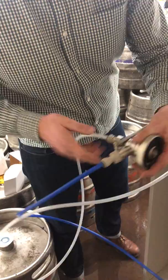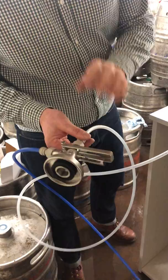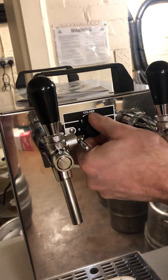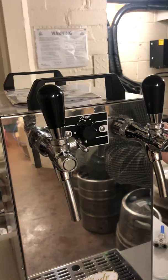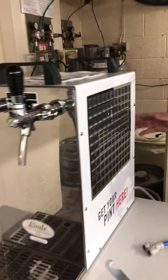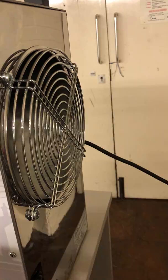So that's all the components installed on the machine. We can now connect the machine to the mains supply. We can switch the machine on at the front — zero being off, seven being the coldest setting. So if we turn that round to seven, the machine's just kicked in as you can hear. That will run for probably around five minutes to come down to temperature. Seven is the coldest setting, so we can hear the refrigeration deck running. If we look at the rear of the machine, we can see the fan spinning — that tells us the machine is currently running to bring down to temperature.